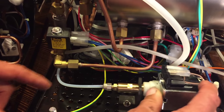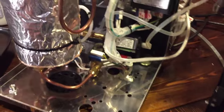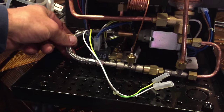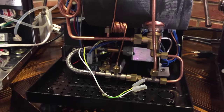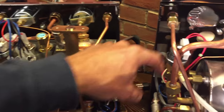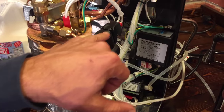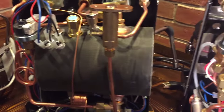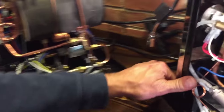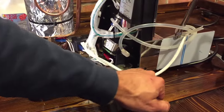The Teflon tubing is done for a couple reasons — first of all it cuts vibration down, because when the pump moves it picks up a lot of vibration. The Expobar also has a stainless steel line that serves the same function — it's flexible so it dampens vibration. They all have pressure stats; the Expobar has a little cover on top to keep any steam that gets inside the machine off of it. What's also nice about all these machines is the frame goes all the way through them front to back as one solid frame — in the Expobar's case it's stainless steel.